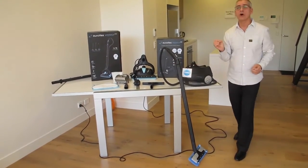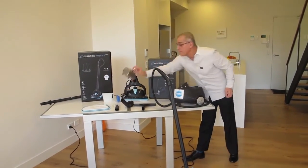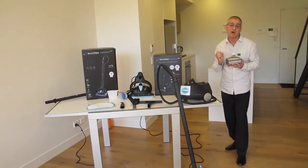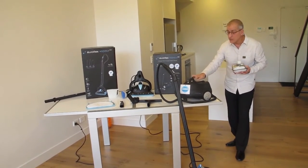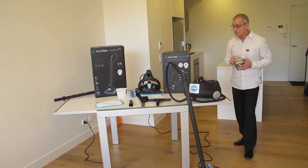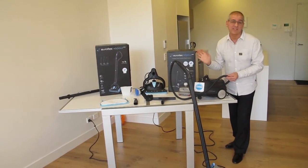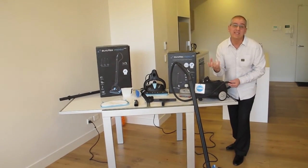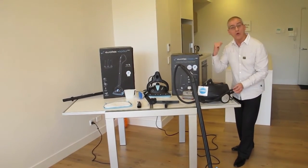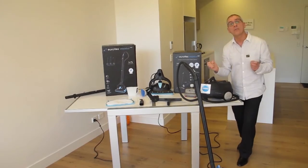The last thing to cover is common user errors. Failing to read the instruction manual, overfilling the boiler, and putting anything other than tap water in the boiler will void the warranty. The green lights on the units will fluctuate on and off as the thermostats cut in and out to save power costs. For this unit, if the customer stops cleaning for about ten minutes, the steam in the hose gets cold and recondenses into water — they should drain that moisture into the sink and then resume cleaning, and the dry steam will flow as normal.